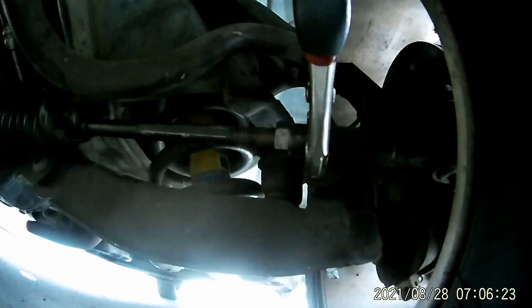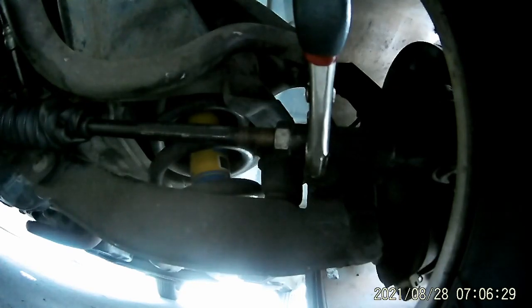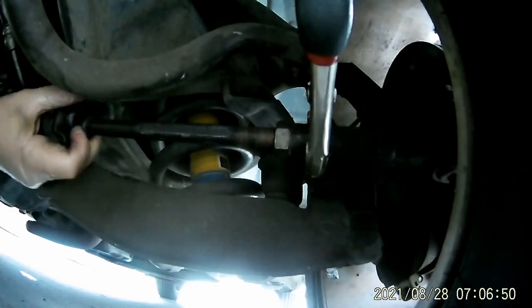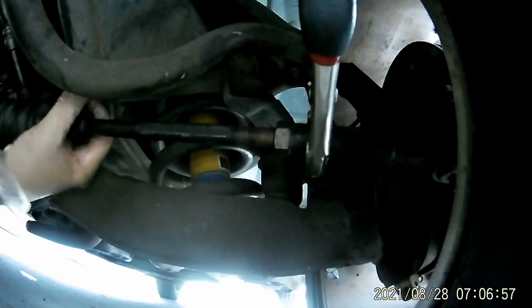This truck is supposed to have just a touch of toe-out. Toe-out is slightly better than toe-in — toe-in is going to make it wander and not drive correctly. I see that for some reason my boot didn't stay in place — looks like the liquid wrench dried up and now my boot's all bunched up. I think it needs to turn back this way.